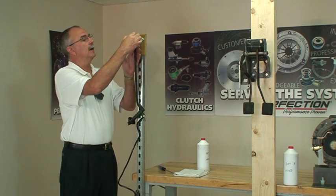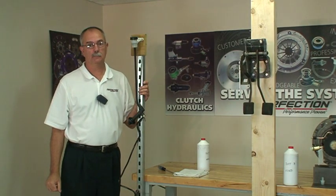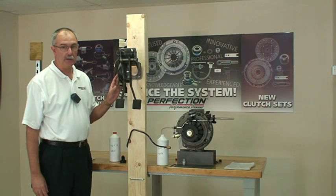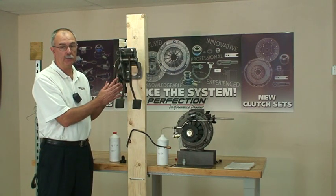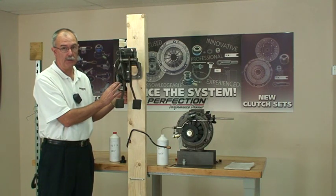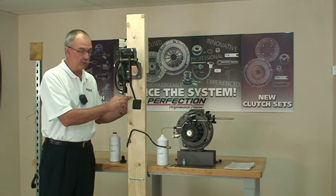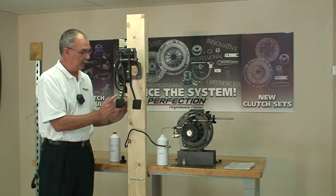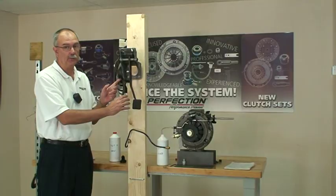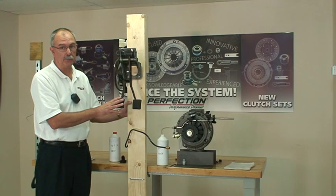We're going to go ahead and cap this off and attach it to the pedal cluster assembly, check it over there, and then start the gravity bleeding process. I went ahead and installed it in the firewall and into the pedal cluster assembly. This can be kind of tricky — you might want to pay particular attention to how the old system was removed. Sometimes there are little fingers on these master cylinders that show you the correct orientation. Once it's installed, go ahead and install the new pushrod into the master cylinder. When you get it pushed in there and before you connect it to the slave cylinder, you can tap on the clutch pedal and see just how little it moves. No more than one-eighth, maximum three-sixteenths of an inch pushrod or piston travel. This one's real firm, so we're going to go ahead and continue with the rest of the installation.